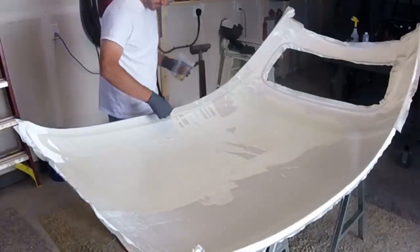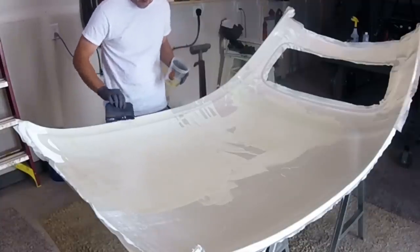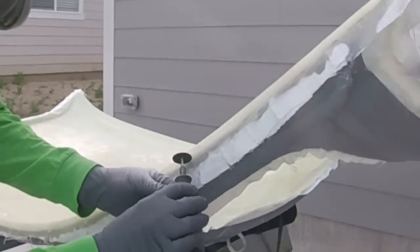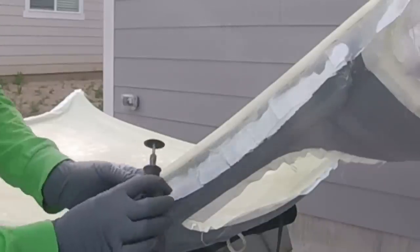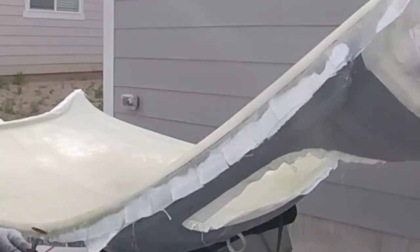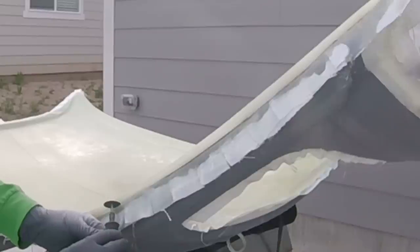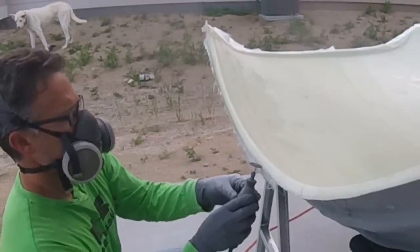What you're looking at here is probably a solid three or four hours of just lathering resin around and laying down all the fiberglass cloth. I did at least three layers, a little bit more by the back window. It just goes on and on. Now I've got the piece pretty much ready to be separated. Before I separate it, I'll do what I call a rough trim, because trying to separate it with all this fiberglass cloth hanging off is a nuisance — it makes it itchy. So I do a rough trim and then it's much easier to work with.